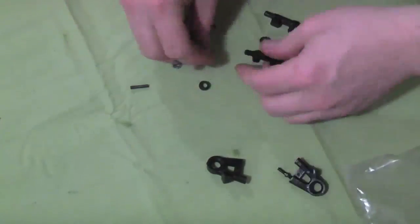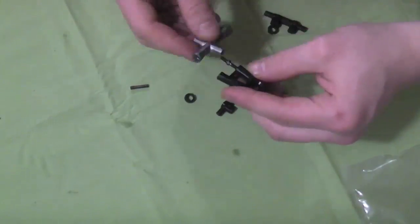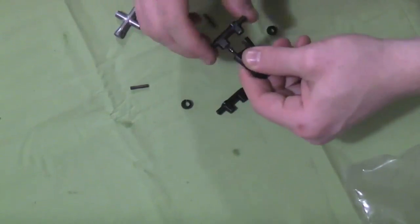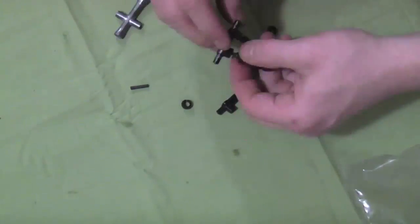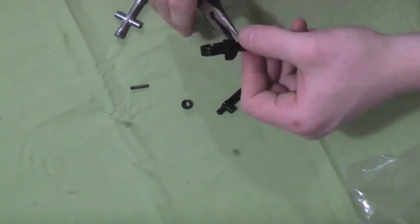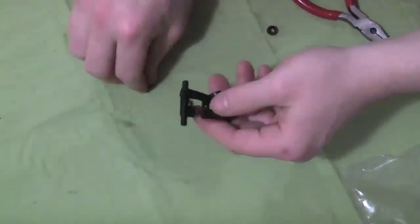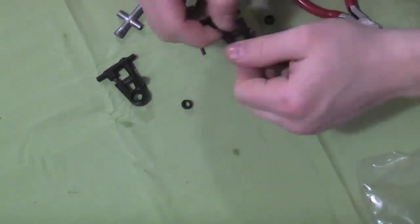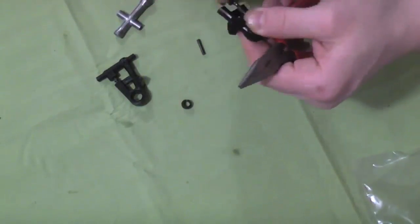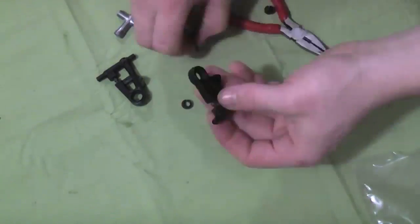Start assembling the front — it's a two-piece for the front A-arm. I'm pretty sure that gap is 3.5mm as well. Once that's in, put the opposite side through and then there's a retaining pin that just needs to be pushed through the A-arm to hold it all in one piece. Just worked with the gap to make sure we were tight on both sides.